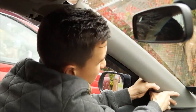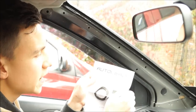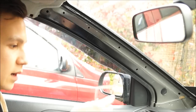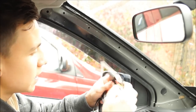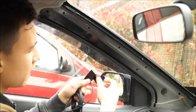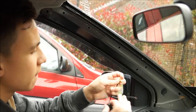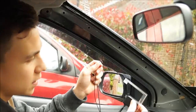You have to wiggle them about until it comes out. Looking at the instructions, this is the DAB AA1 digital aerial from Autoleads. It has basic instructions and is fairly straightforward. You have a stick-on aerial unit, and this black part needs to be stuck onto the metal — even painted metal — just to ground it. Then there are two wires coming off it that go into your head unit, one of which is for powering the amplifier.